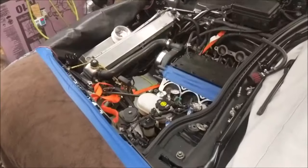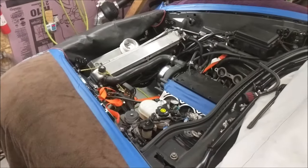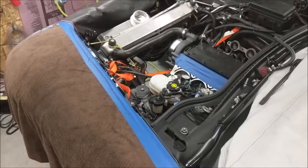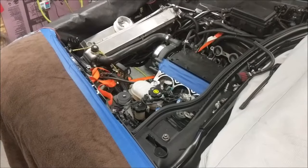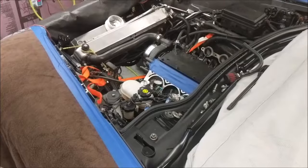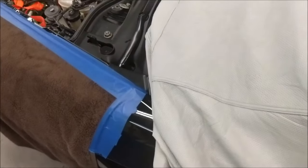Okay, so I took the rubber hammer, and I just took the handle, which, it doesn't really matter that it's a rubber handle or a hammer, I guess. But I pushed the piston up so that it got just past the rings. You basically push the butt of the handle against the end of the rod, and then you just slightly tap with the palm of your hand the top of that hammer. I was not able to lower the car. I got to move the cradle, so I'm just standing on the hoist, lowered as far as I could.